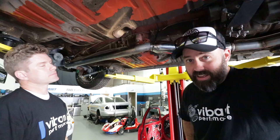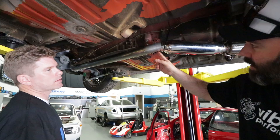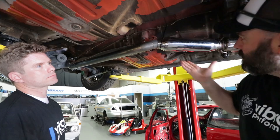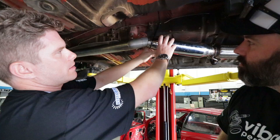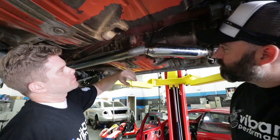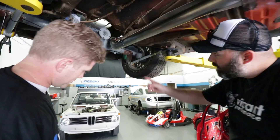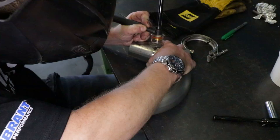Jay's been busy — he put a nice little jog in the tube here, and now it's a nice straight shot back to the axle. This jog was required for better fit. We've got the resonator right under where your seat would sit, so we want to keep the pipe as tight as possible to the bottom of the car. We brought the bottom of the pipe level with the bottom of the resonator, knocked it up a bit, put a little jog in there, and now we're straight back to the over-axle area. And there's a 1490 V-band connection on this upturn — just got that welded first, then tacked to the end of the pipe.